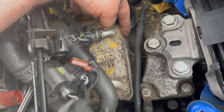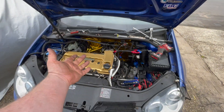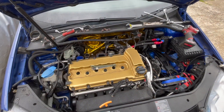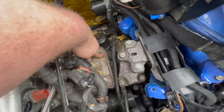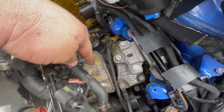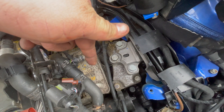You know what that means — this little thing is broken. So that's our issue, not the head gasket, which is actually a good thing. I've started taking the engine apart, but I needed to get that off anyway to get the face skimmed. There's only about an hour's extra work. I'll replace this DSG oil cooler, and I bet that's our issue — this is the oil cooler on the gearbox, mixing the coolant in there. It was the one already on the replacement gearbox when I bought it — I didn't fit my own one. I'll buy a brand new one, and I'm willing to bet that's my issue. If only I'd checked that a week ago the video would have been a lot shorter — but I can probably get an uprated thicker one anyway.